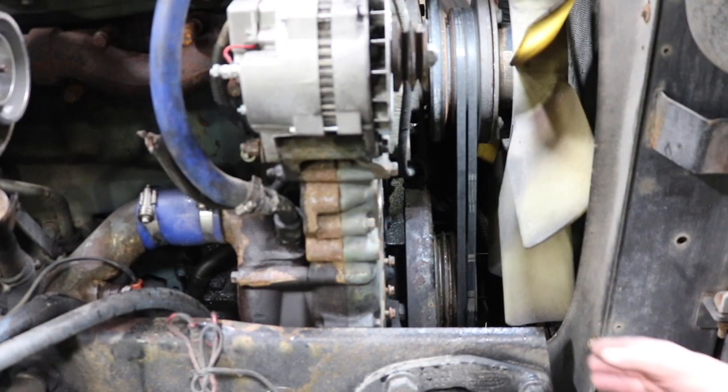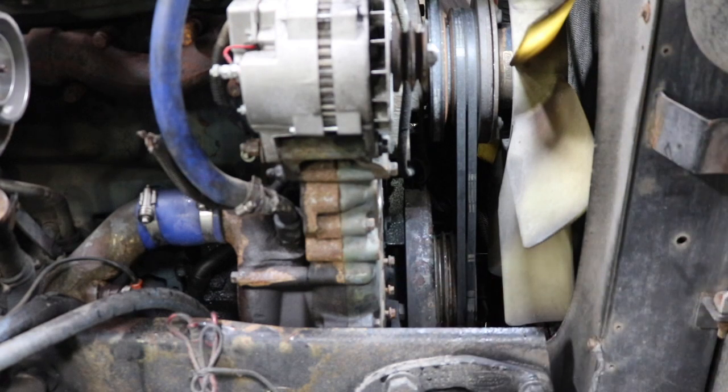As you can see here, this is a vibration dampener that Bruce is always speaking of. It takes up the torsional shock in the engine. This was rebuilt 140,000 miles ago and that was not replaced — that's a commonly skipped part during a rebuild. So that part could have an unlimited amount of miles on it. Detroit doesn't specify a replacement mileage limitation, but Cummins does and they recommend it at 500,000 miles, so we like to do everything at 500,000 miles.